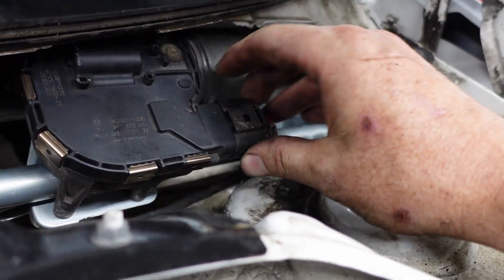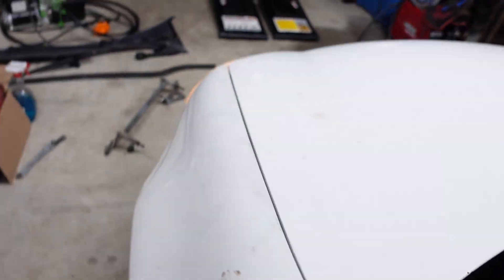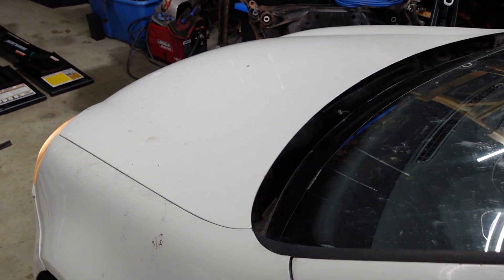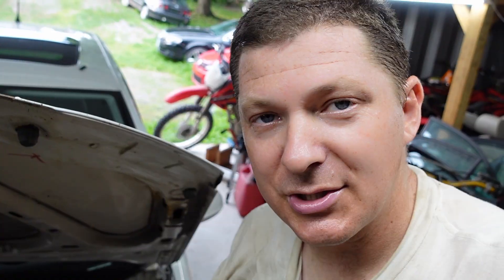All that's left is to plug in my electrical connection here. Now to give it a test, we're just going to close the hood and watch that guy - everything seems to be working fine. Now don't ask me how I know, but you have to close the hood - otherwise nothing works at all. If the car senses that the hood's open, it won't activate the front wipers. So fun fact for you guys. There you have it, that's all for that. New wiper linkage in - all I have to do now is put my cowl back on, put my wiper arms back on and we're in business. Thanks for watching and we'll see you guys in the next one.